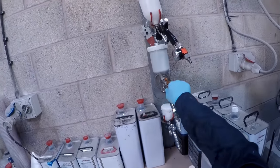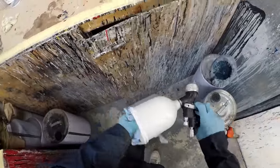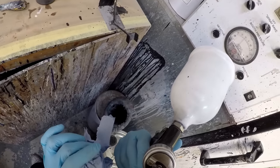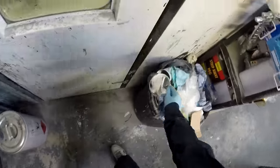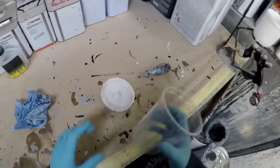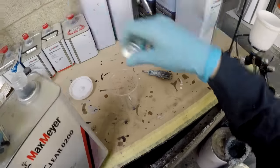It takes a hell of a lot of practice to get used to the best prepping methods and also knowing the cleanest area of your booth. For me, right in front of the filters at the front is the cleanest section — I find if I put stuff at the back I tend to get more crap in it. So for a big job like a Citroën C1 I'll put the bumper behind the car where it'll get more dust, and keep the car towards the front since the car has the majority of the paintwork.